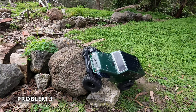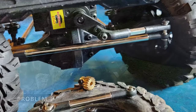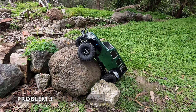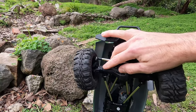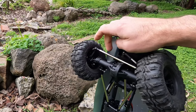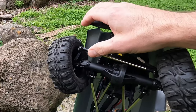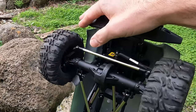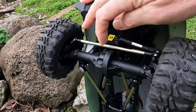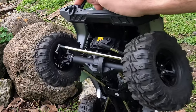Still using the stock servo. I also had to change the servo arm just because I needed to get it to the outside, because it couldn't go far enough inside before. Can't do three, but I'll show you what I did with the steering. I cut off the heavy nubs that were there and also cut off the limiting stops on the inside of the steering arm, and I drilled two small holes, one above and one below.